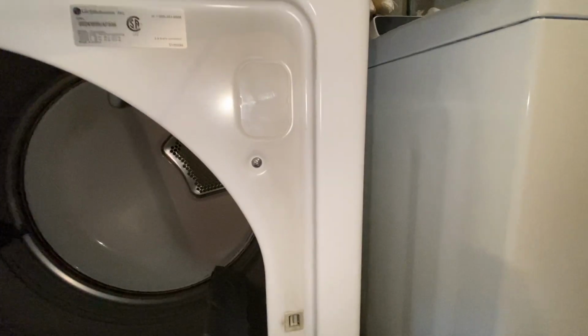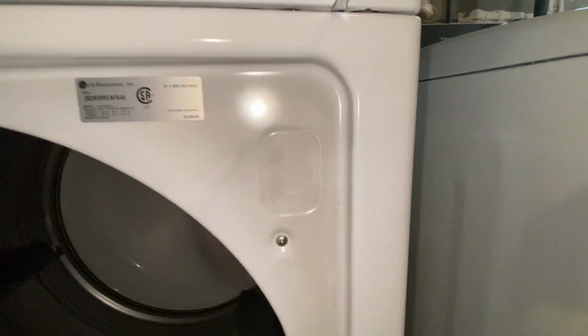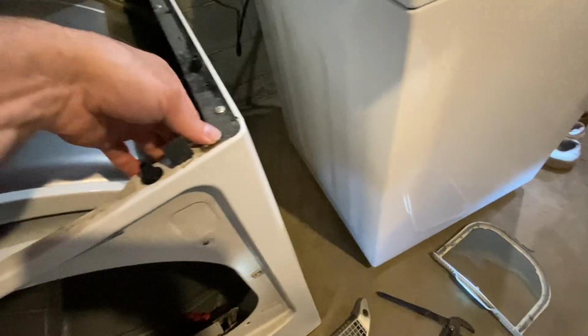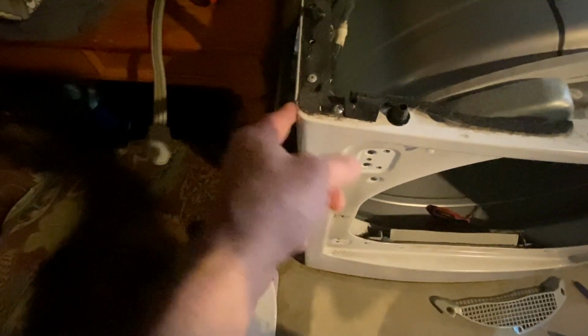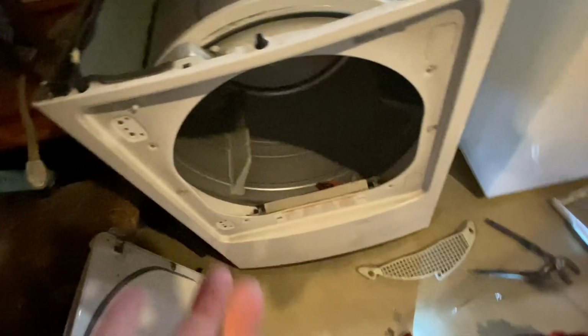I know that in there is a way to lift this off right through here. You can see there's a little slot. All right, so just like a car hood, got something to prop this up. This just snapped in with these clips, so you just give it a good pry and it snaps out. Okay, so now we're going to get this face off. It looks like we possibly have to loosen one screw here, and there's 4 screws here, and that should come off.